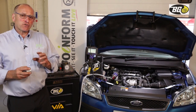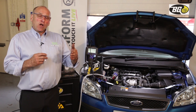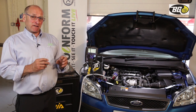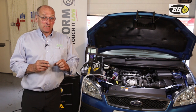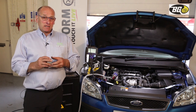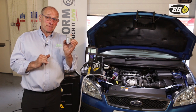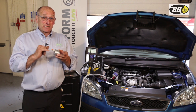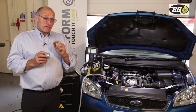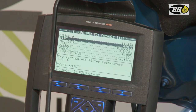Welcome back to this very crucial part of the process. We're at the end of the loading phase — the car has now been running for about half an hour with product being delivered into the engine system. Bear in mind that the control variables are engine speed, the size of the orifice in the vortex generator, and the jet size. We've achieved a temperature of just under 500°C.